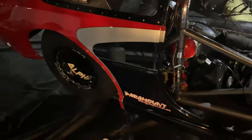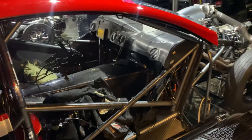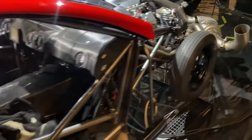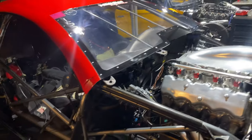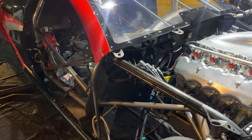The four link worked great, separation had good leverage, and did everything we wanted it to do. Just the converter, you can see from the data and the times. So we're cooling it down now, got the engine crane and our jig, and we're gonna pull it up and change the stator. Well, I'm taking the tail shaft off. Dad's got the sump out.